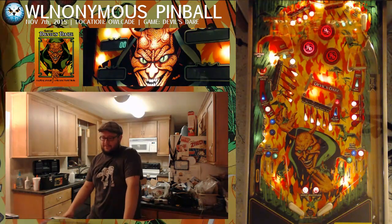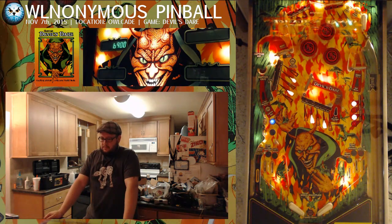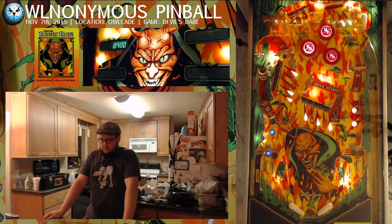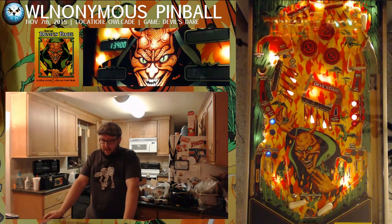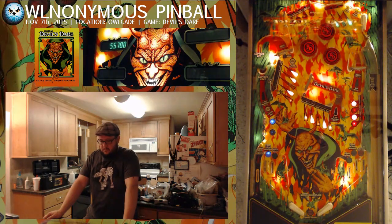Last game. Those drop targets are staying up high. I didn't even see that yesterday. I don't think it was doing it yesterday. Like I said, that's just cleaning and the spring adjustment.